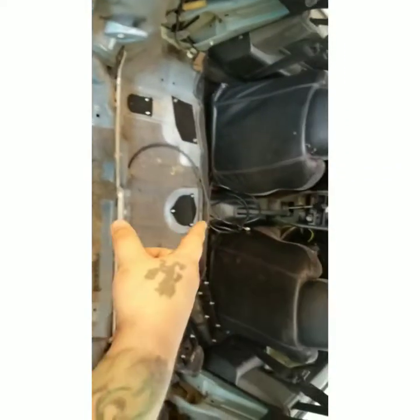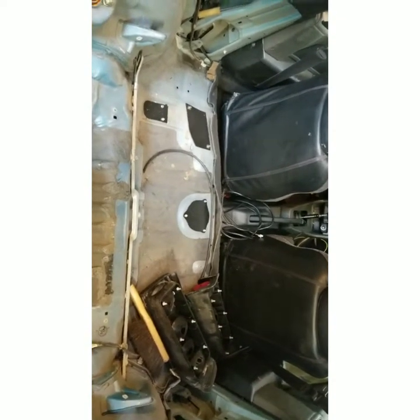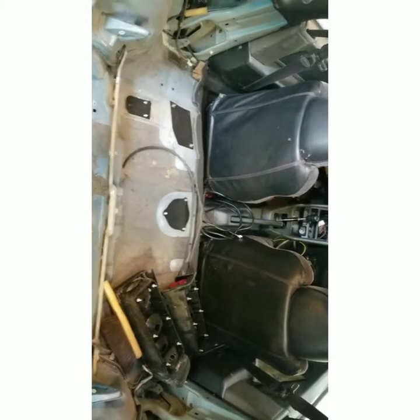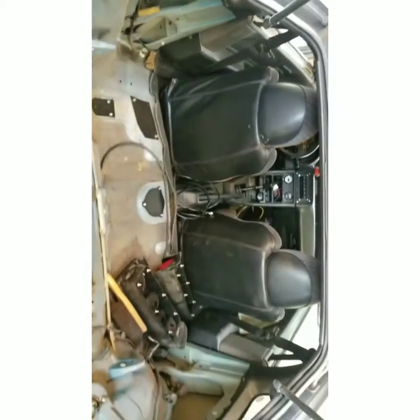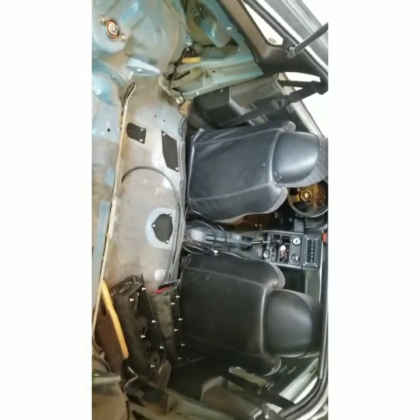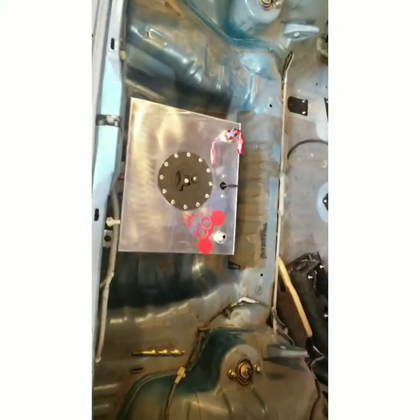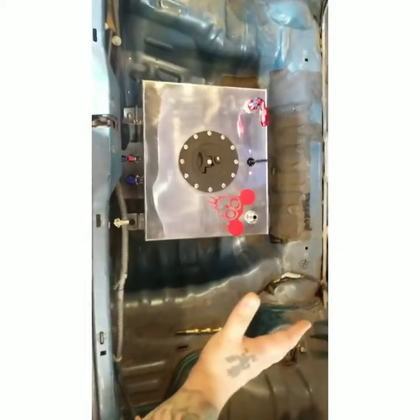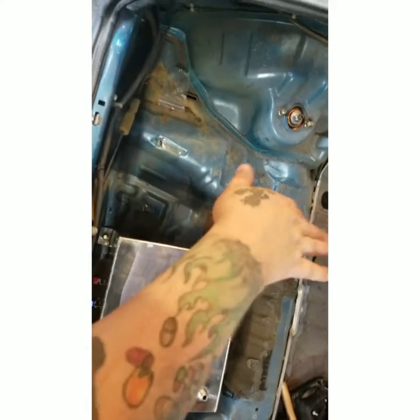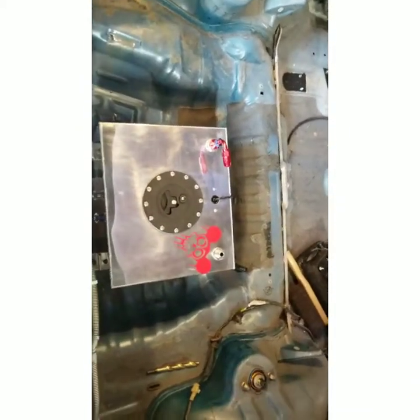The main issue is where I'm gonna put the bottle. I don't want to put it straight in the back because I'm trying to keep the weight off the back, so I might put it dead center right there. I still need to get a bottle mount. Depending on where I put the bottle is where I need to drill the hole to run the line up front or underneath the carpet. I have to look up regulations first before I can go any further — this is probably gonna be a three or four day process. I want to make sure everything's done properly so when I take the car to the track I don't have issues. I also have to make a firewall for the fuel cell — essentially a box that bolts in when I go to the track and unbolts when I'm out.